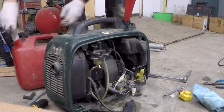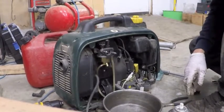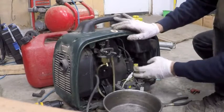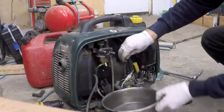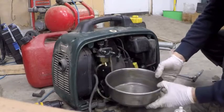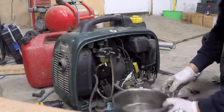Probably shouldn't have put that much since I don't know if it's even going to work. I noticed when I was looking at the other side — this actually has a fuel pump. This might get a little bit messy. So it is pumping and the stuff that it's pumping through looks pretty nasty — it's very yellow. So I'm going to try to keep it running with the ether until we get clean gas pumping through.